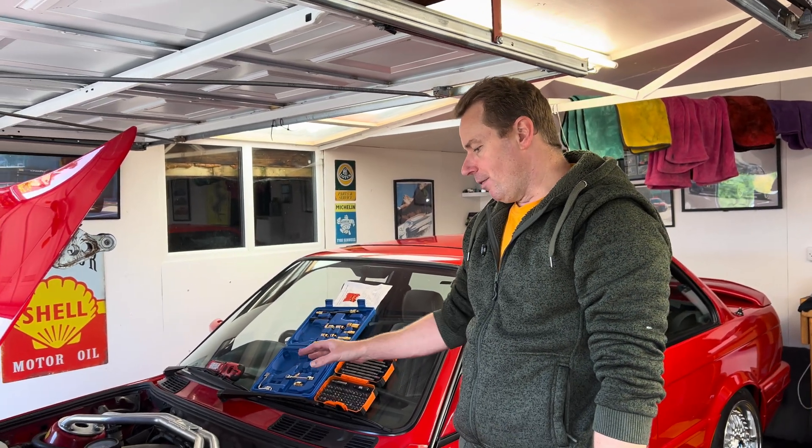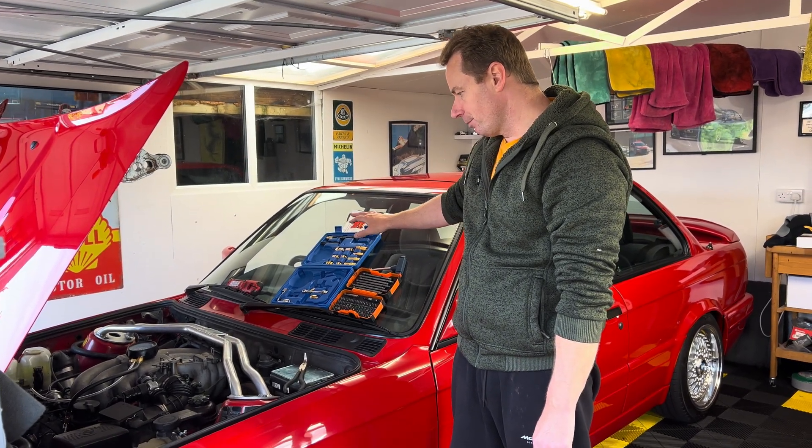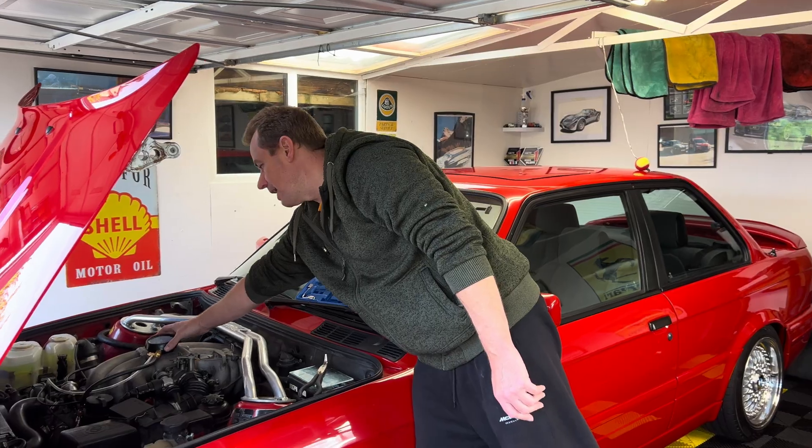From this test I can assume my fuel pump is good, my fuel pressure regulator is good, and I have no blockage in the return pipe. The car is running nice and healthy — all with a £25 fuel pressure kit.